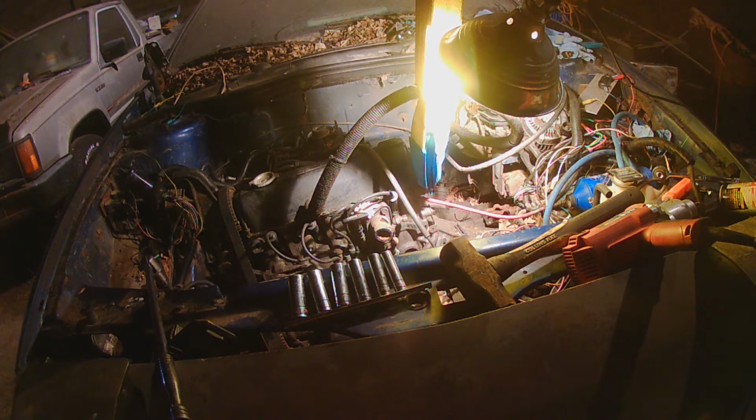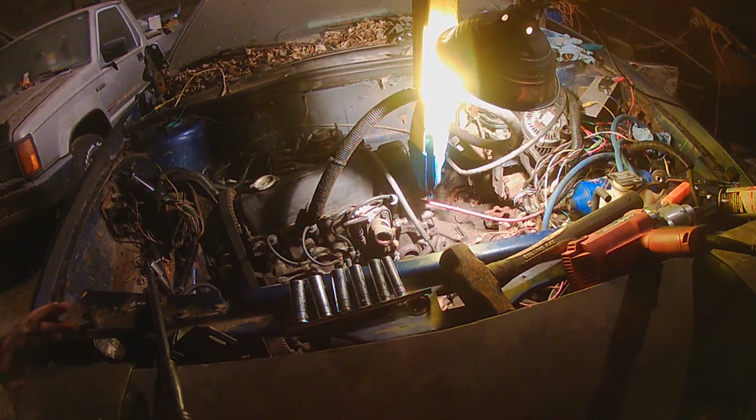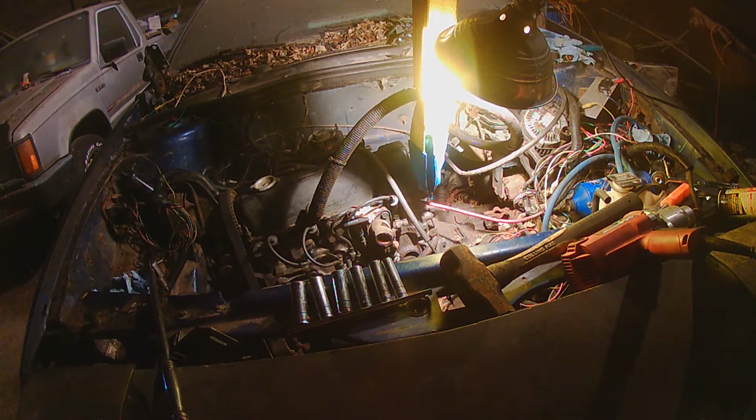And then a little bit later, I disconnect the throttle cable and the cruise control cable. I'm trying to think. I don't know if I need to. I don't know what I need to do to make the cruise control work on this. I mean, it's still got the servo on it. I don't know if that'd be compatible with that JTEC Magnum engine controller, 1998. But I can find out. If I could get that to work, that'd be really cool. Even if I have to put extra buttons on it, if the steering wheel buttons don't work anymore. I'm imagining the steering wheel buttons probably won't work with the JTEC PCM because it's newer. I don't know if they changed anything, but I'm assuming they probably did, because they're Chrysler and they like to make changes that break your aftermarket stuff.